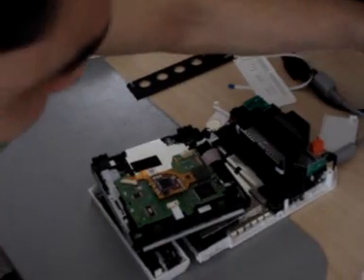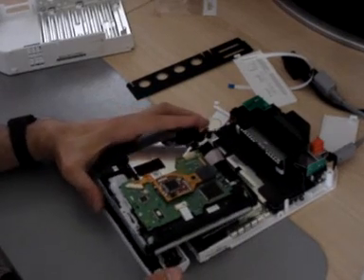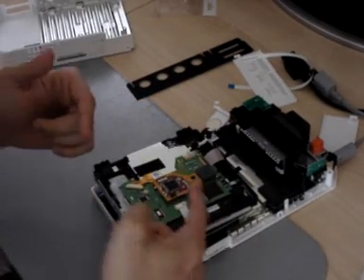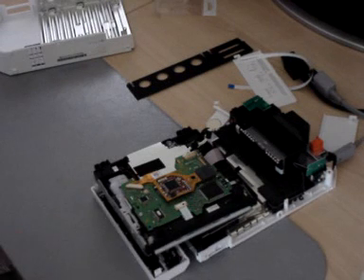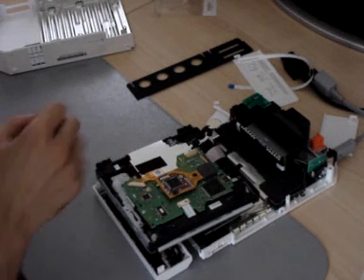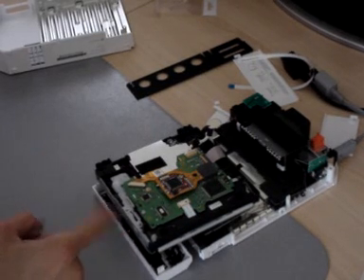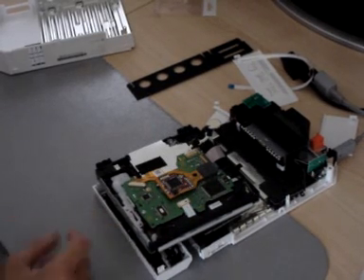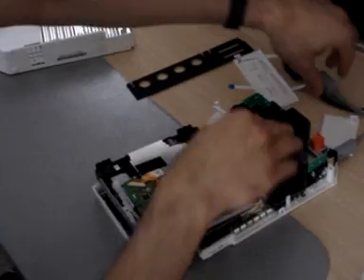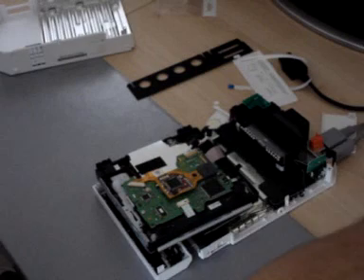Alright, so that's pretty much it. You can chuck in the backup like this, and you'll see every time it does that sequence of red light, blue light — it just means that the modchip reset and the drive. It'll disable itself when you put an original game in; basically once it starts reading it'll start flashing. Once it makes this sound, that little tiny sound where the laser moves, that means the game is read and already on the screen.